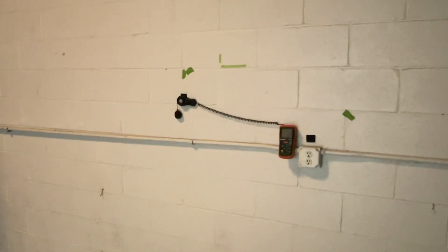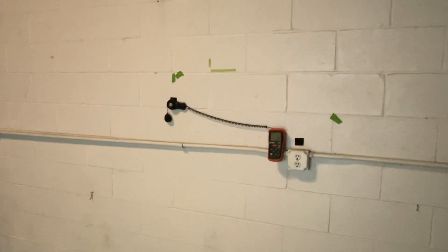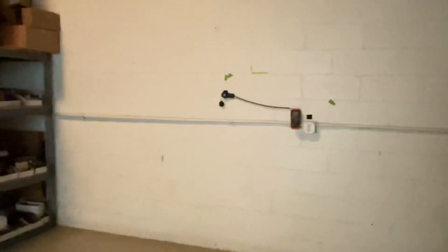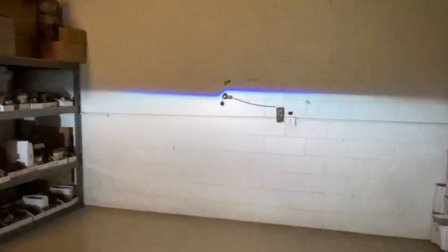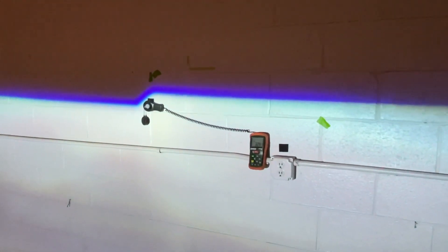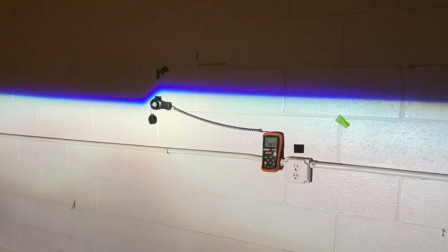The CBI has been out longer than any of these bulbs and was one of Osram's main novelty bulbs. It stands for Cool Blue Intense. A lot of people got the Osram CBI and might have been disappointed in the color temperature — it wasn't really blue even though it was marketed as a cool blue intense bulb. Sometimes it didn't even change much from the old worn-out bulb it replaced in terms of color temperature, but the performance was much better. People confused that, and maybe that's why they weren't super satisfied.